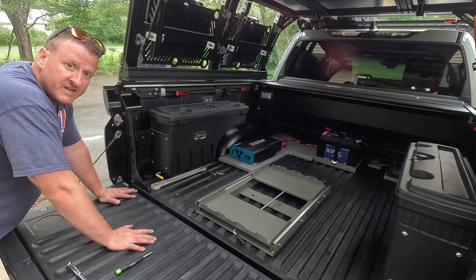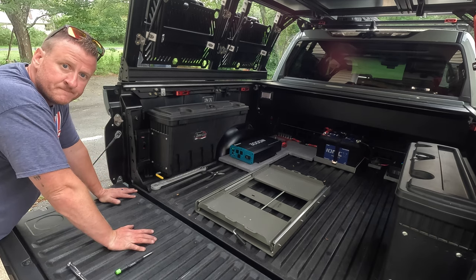So if you want to add these bed stiffeners and you have swing cases, now you know it works. I know this probably wasn't my best video, but I just wanted to make a quick one showing you that these swing cases will work with bed stiffener brackets — especially the Rago Fabrication brackets. If you have any questions on anything you saw, drop them down below, but it's pretty straightforward. You just got to open up those two holes and give yourself enough room to get these bolts from the bed stiffeners through the swing case bracket. Don't worry if you make a little bit too big of a hole — the washers from the Rago Fabrication brackets will make up for it.